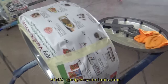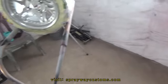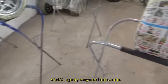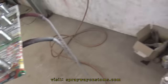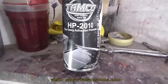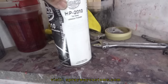I got all the wheels masked off now. I also went on and wiped everything down with some wax and grease remover. I'm gonna take my air hose and blow everything off. Now, and after I do that, I'm gonna go ahead and spray my adhesion promoter. It's the Tamco HP2010 Top Dog Adhesion Promoter. I'll put everything down in the description, everything I'm using.